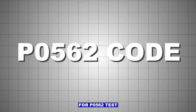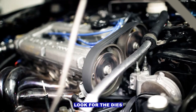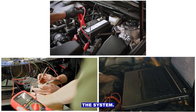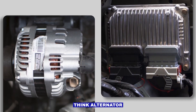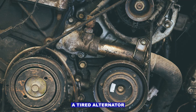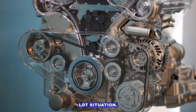My order for P0562: test battery voltage with engine off; test charging voltage with engine on; look for the dies-in-gear-after-jump symptom and test the alternator right away; load test the system; inspect terminals, grounds, and wiring; check belt condition and tension; only then think alternator or PCM. Most of the time, this is a weak battery, a tired alternator, or a bad connection. Fix it early and you'll avoid the dead car in the grocery store parking lot situation.